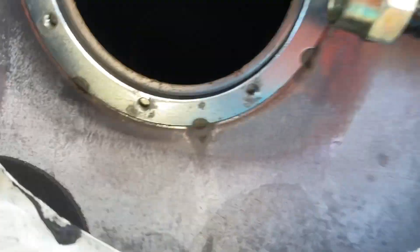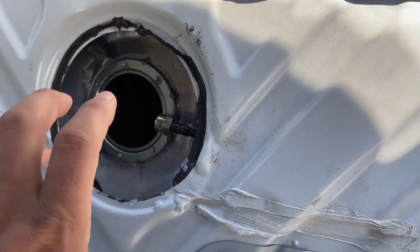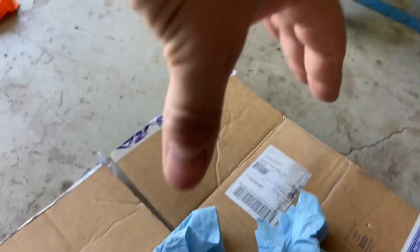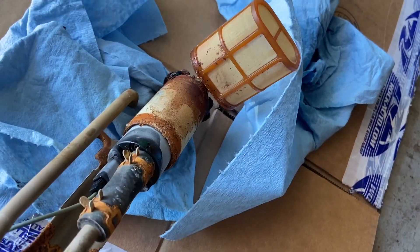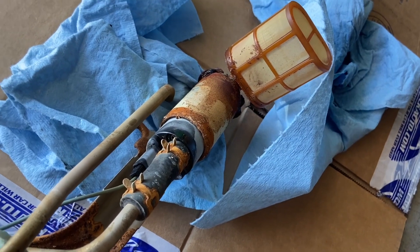Alright, so that's out. I'm going to show you guys inside the tank. I really hope it's normal for there to be a little bit of rust in there. Getting that out was a hoot — it was those screws, but it's getting it twisted. Once you finally get it, the lines will puke a little bit, so obviously have a towel here or something. These are going to puke some gas. You got this little screen thing and everything's a little corroded in there. Hopefully that's not incorrect for the year and the miles — it's got 40,000 miles on it, it's in really good shape. I'm just going to change out this filter now, which isn't rocket science.